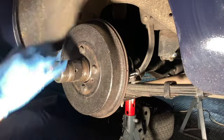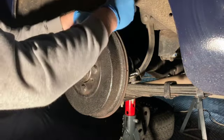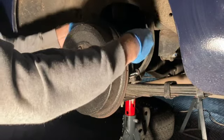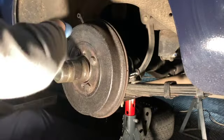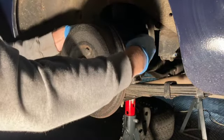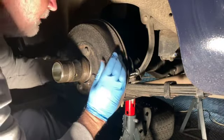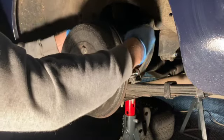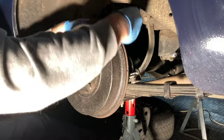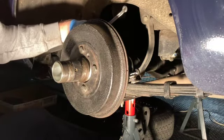Talk about it being free running, but of course you're working the diff and the axle, so it's not nearly as free running as, say, for instance, on the Mini, where it's a trailing wheel. But to finish this off properly, we're going to have to put the wheel back on. We just want to access it, which is much easier before you put the wheel on, and you know that you've wound it back quite a way. So you might as well get it roughly right without the wheel on.